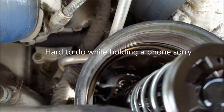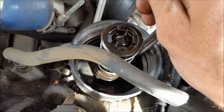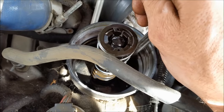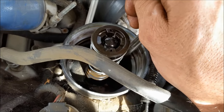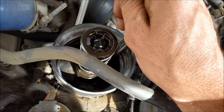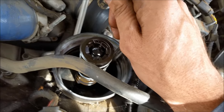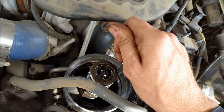Let's see if it fills up — boom, got oil pressure! So that's what you do: disconnect the oil relief valve. If the spring's tight when you pull the cap off, it's probably hung up. Pull out the spring first, then the piston. Put a magnet in there to get the piston out, then put a magnet in the hole to check for debris — which is what I found. That was the problem. I'm still holding the plunger down and the relief valve works.